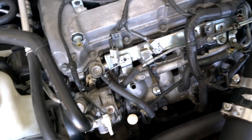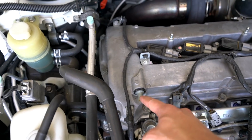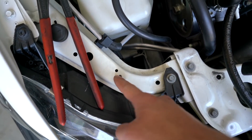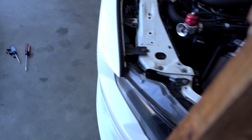That's all you need to remove from your engine. The half-inch hose is going to connect there and the 3/8 hoses are going to connect there. The catch can is going to bolt to the headlight bracket right there — there's a threaded hole it's going to bolt to. We need to get some of these AC lines bent out of the way just to create some clearance for the catch can to sit right down in that hole.